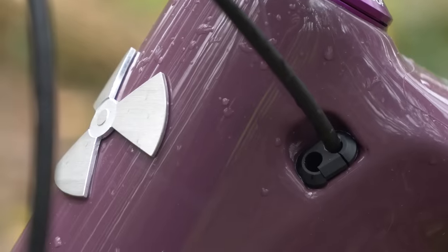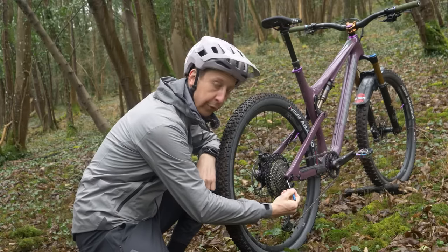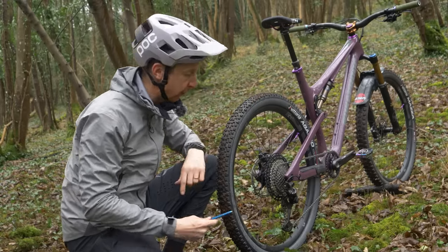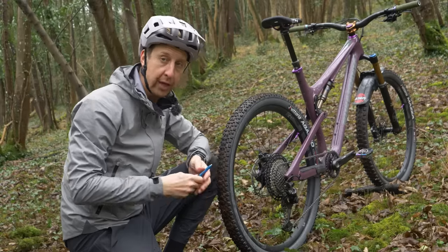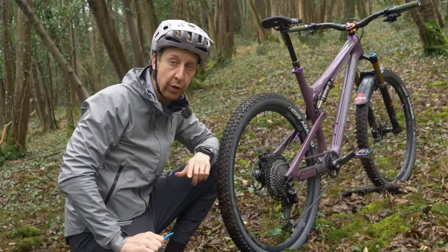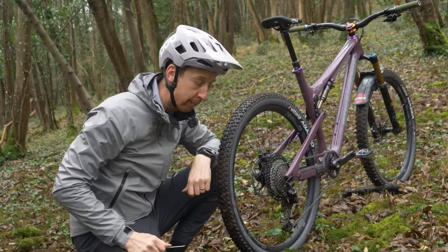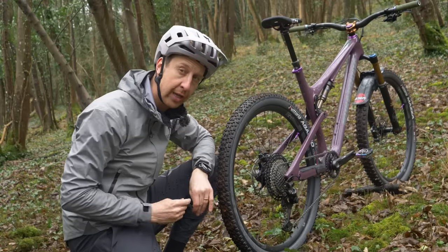The last thing to check is the cable routing itself. Make sure you have a good route from the shifter at the handlebars all the way down to the back of the bike. Make sure the cable itself isn't too short, and you need to make sure that the ferrules are actually sat into the stops correctly. On my bike I've got basically a constant length of outer cable that runs from the shifter inside the frame and all the way to the bottom, so the only one I have to check is this one here. If this pulls out slightly, then under pressure when you're trying to change into a lower gear — that's a bigger sprocket — it's going to move around. You're not going to get the gear shifting you need, so make sure your ferrules are in. Your bike might have external routing with several cable stops, so check all of those stops. The last one to check is the actual derailleur cable — the way it actually bolts on. Check the orientation of this because it's super easy to have it going the wrong way, and yes the gears will work, but they will never be quite perfect. It just goes around a little curved radius and it's held in place by that pinch bolt — just double-check yours is in the correct position.